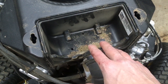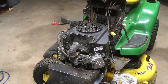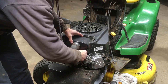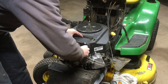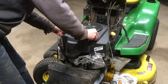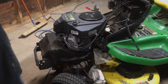What I want to do is cover up this inlet hose into the intake and then just brush that out with a rag — I'm not going to blow it out because I don't want any of this to fly down into the engine. I'll slip this new filter in — it's kind of the reverse of taking it out — tuck that in, tighten the clamp screw, get the cover back on, and that's that.